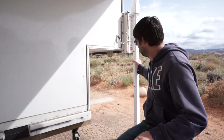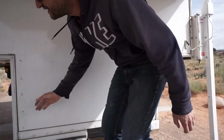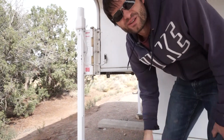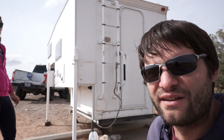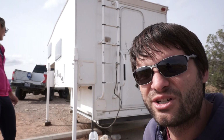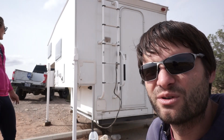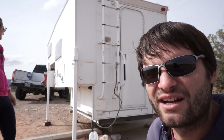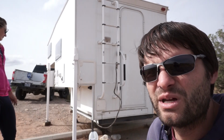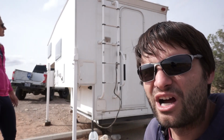And it helps just the load to not be carried on the outside of those jacks in the front, because really those front two legs carry probably 80% of the weight of the camper. The rear two legs really don't do a whole lot, which is also why you always want to keep the front tipped up so more of the weight is on those back two legs than the front two legs. But it does get a little unstable, as you saw when we were pulling it up, how it started rocking a little bit.